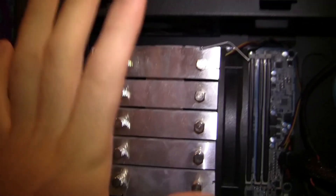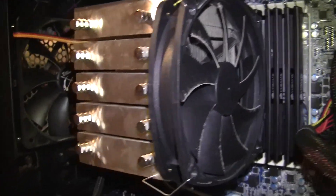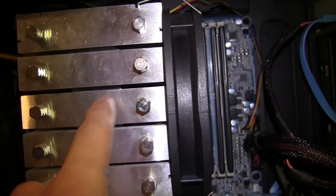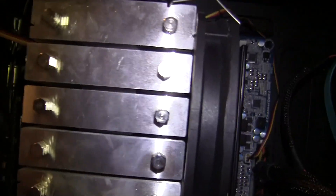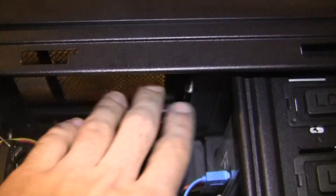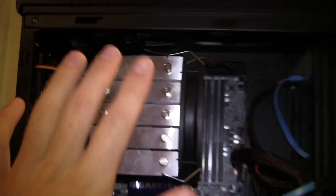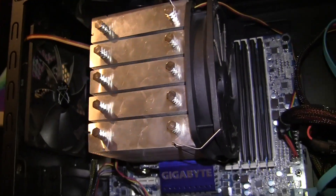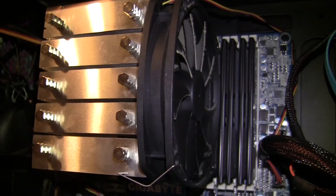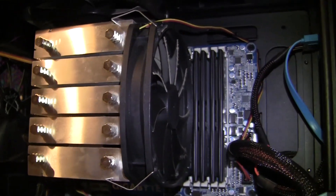Moving up here, the big thing jumping out at you is my very large CPU cooler — it's a Scythe Mugen II Revision B. Basically, it's a brick. Each one of these is a heat pipe leading up from the CPU, which is down in the center. This is all vented, and the fan blows all the air out, then my case fan blows it out of the case. I also have a fan up top and plan on getting another one soon for great airflow. This is how I'm able to overclock — I'm currently at 3.4 GHz, dialed back from my usual 3.6 because my room gets very hot.